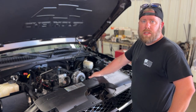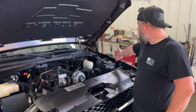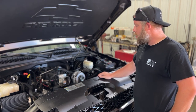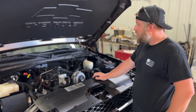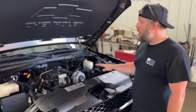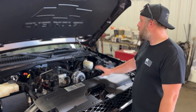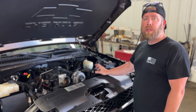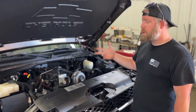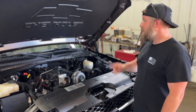Hope you guys enjoyed today's video. We talked about how to do the read file on a P59, what fuses to pull when flashing a P59, and how to diagnose a bad throttle body by looking at idle airflow values. We're going to have to go into a part two — tomorrow I'll put on the new throttle body, get this thing on the dyno, strap it down, and get it fully calibrated. Thanks for the likes, comments, and subscriptions. See you guys tomorrow.